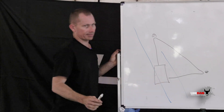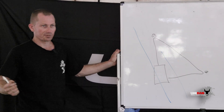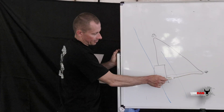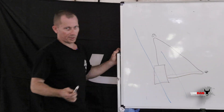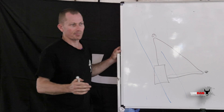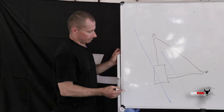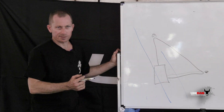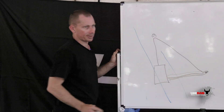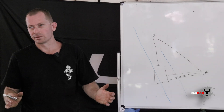That gives you 10 ton there and 10 ton there. Maybe you don't want to pull yourself forward that hard — you just need to pull the rear of the vehicle sideways. Just pull a pulley block there, anchor it back to the tree, and now you've got 20 ton. We're talking the full load of the winch — you probably won't need that much to pull the vehicle sideways. If it's still pulling you forward too much, just add another pulley block and come back to an anchor point.